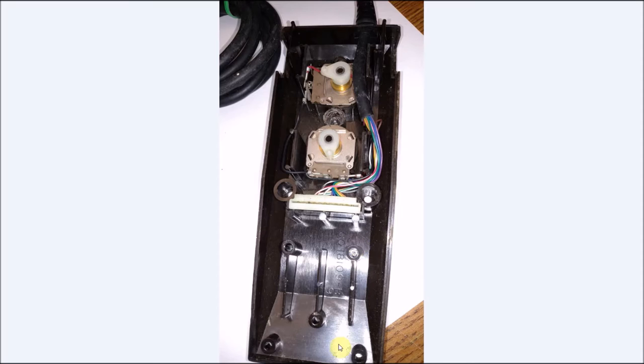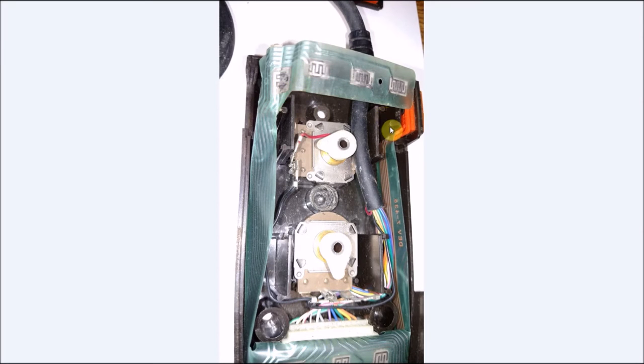So, again, when you're taking out the flex circuit, you can see over here and over here, there's usually some double-sided sticky tape. Just be careful when pulling it out. Generally, I would put a plastic extraction tool back here to pry it off, or be very careful if using a butter knife or anything else. I wouldn't recommend pulling on it because you can damage these circuit wires in here. But just be very careful pulling the wire off the plastic tape here and here. Now this pulls out and pushes in. It's not a ZIF circuit socket where you have to pry this up. This wire will just come out when you pull on it, or push in when you push back in on it.